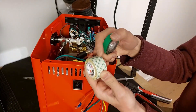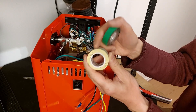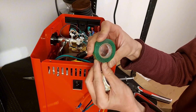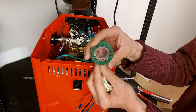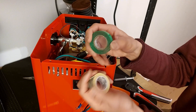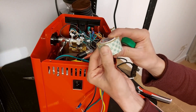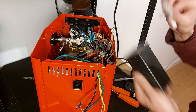For the double-face tape, there are two options: the foam type is easier to remove but less resistant to temperature; the other type is more resistant to temperature but more difficult to remove. In my case it's a temporary installation, so I'm going to use the foam one — about 2.5 cm (1 inch) in width. I'll clean the surfaces with isopropyl alcohol.